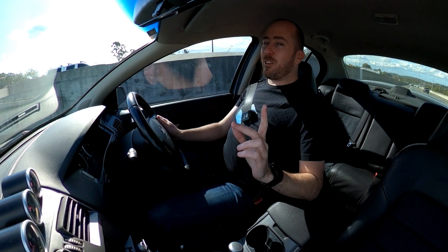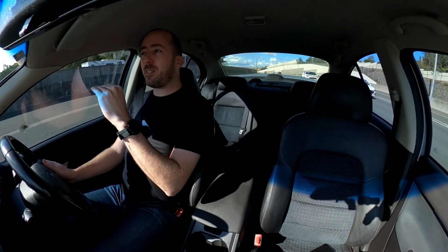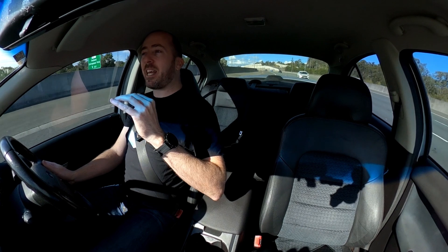There's literally nothing else wrong with this car at the moment, and it's not often that you can say that about a BA series Falcon. So we're nearly there. This is just a quick little update, but I really appreciate all your comments on the previous videos — people with hints and ideas of what I could do. One of them was suggesting I check the angle of the tail shaft in relation to the vertical axis. There are spacers you can add or remove from the center bearing to change that angle, and as far as I can tell, it's all sweet.